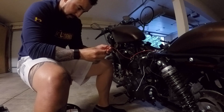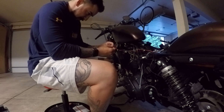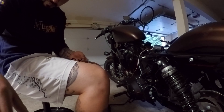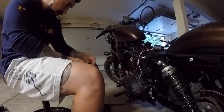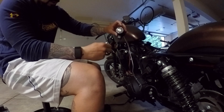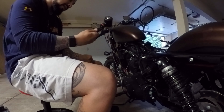The red wire from the push button switch goes to the black and green wire. I really don't have to strip any of these — I've never used polytaps before. Now I'm going to get this F6 location tightened up. I just need to find a 12-volt source because that black wire is not a ground, it powers the LED. There we go, that's nice and tight.